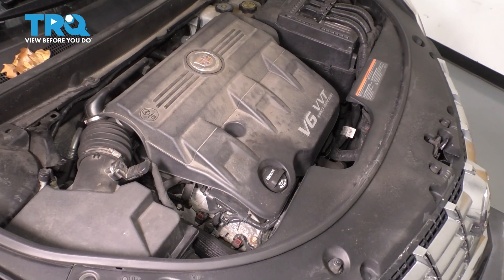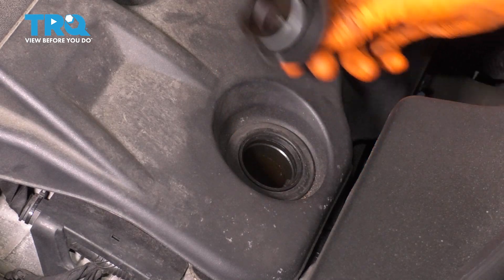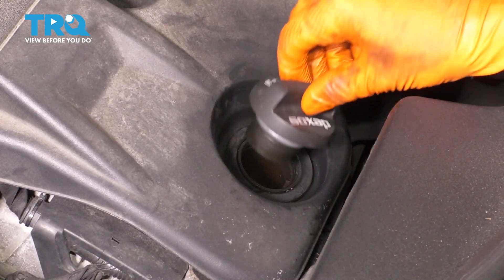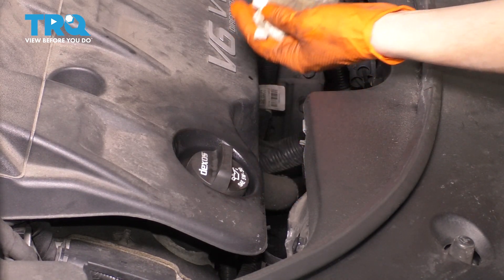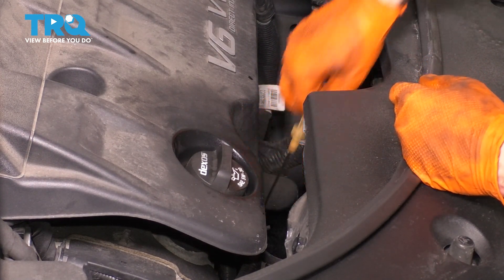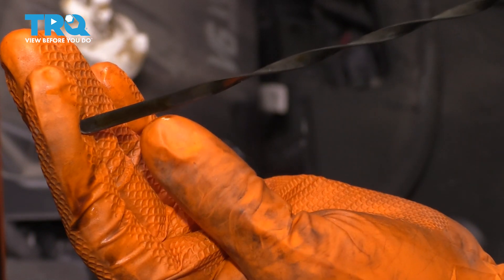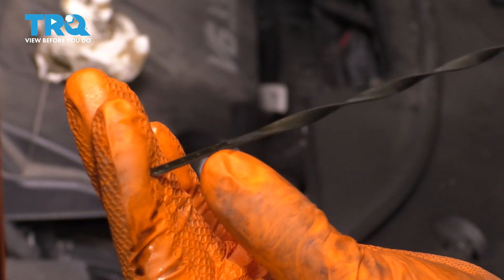Now let's fill the engine with oil. Under the hood, right at the front on the passenger side, is your oil cap. It'll say what kind of oil you need right on it — 5W-30. Make sure you have the right kind. This vehicle takes six quarts. Use a funnel if you want, or just be careful not to spill. Once your six quarts are in, put the oil cap back. Next to the oil cap you'll see the oil dipstick. Pull it out, wipe it off, and look for the oil level to be right between those two dots. Stick it back down all the way, then pull it out again. Ours is basically right above the top dot, which is expected before starting the vehicle. Once you start it, oil circulates and fills the filter, so it'll drop down a little — but that is right where you want to see it.